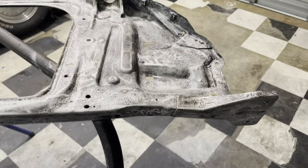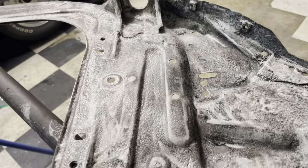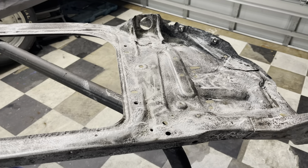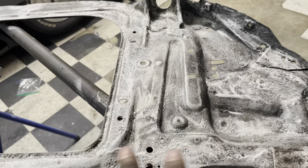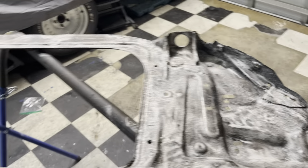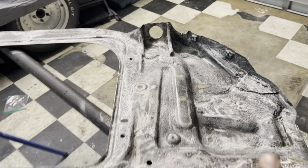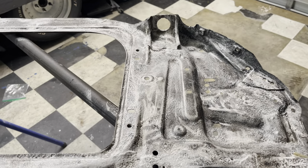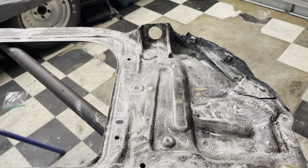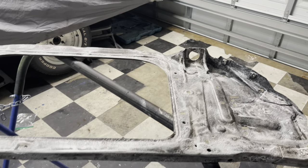This is just the first step. I grinded everything down with my Ryobi grinder here and got it down as far as I can, and I'm using this spray to assist with some of the stuff that's deep within, and then I'll wash it. I'll also add a rust inhibitor. The first step was to grind it down as much as I can, this is the second, and then the third — I'm going to wash it all down with a scuff pad, and then I'll spray a rust retardant on there, which will really kill and stop that rust, and it also primes it. And then I'll see how it looks and keep going until I'm satisfied with the quality of work.